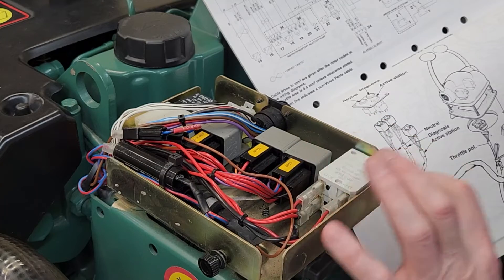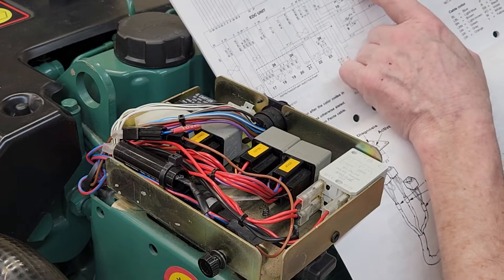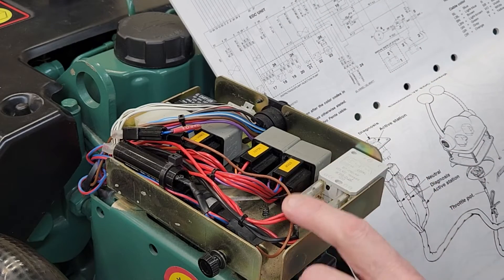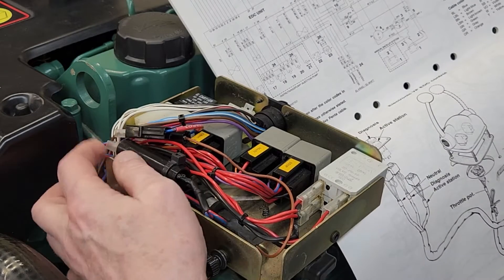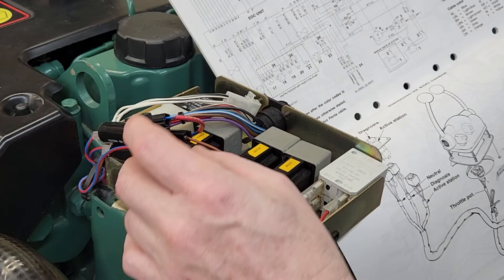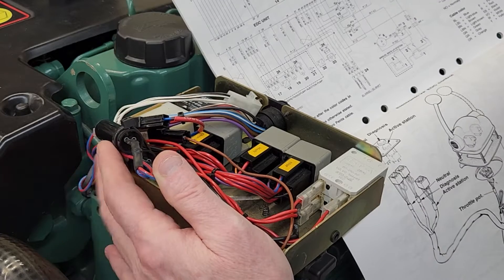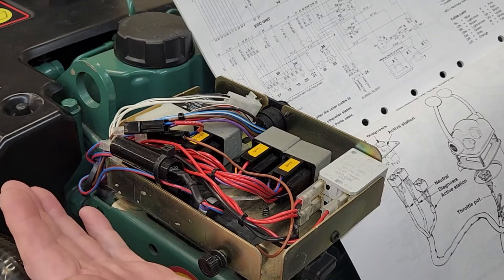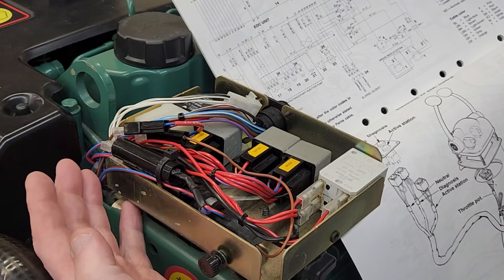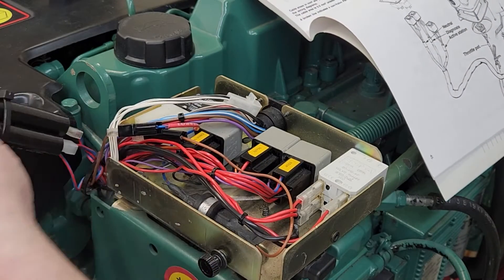There are also two 8-amp circuit breakers — one is on ground, one is on power, and one supplies power up to the helm station. Also connected in here are two diodes. This is for the 44 series and these diodes can go bad. When they go bad they build up internal resistance. All diodes have some resistance, but a failing diode can either open or have excessive resistance. Most diodes can have up to one volt of voltage drop, and that's a lot when we talk about a processor, especially if you also have these small wires that are corroded adding more resistance.